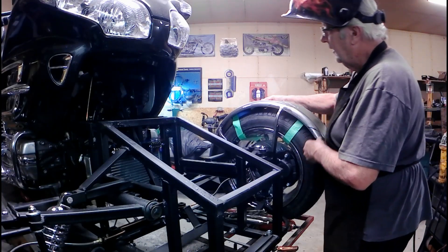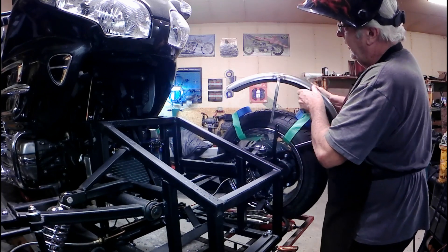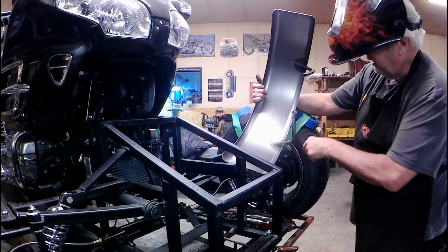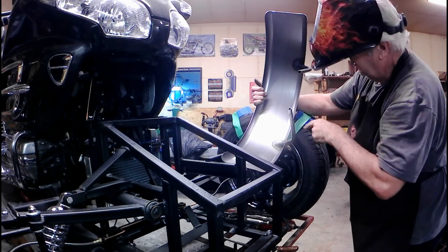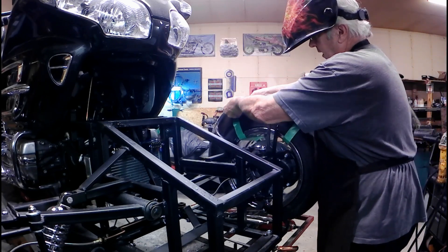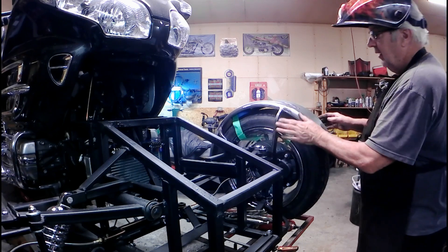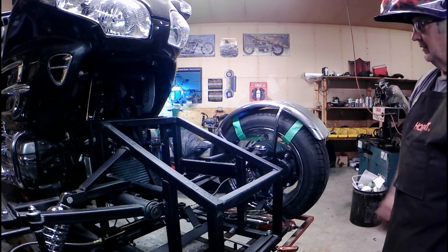I got this guy lumped together here. Looks like I missed right here — I'm going to grind that a little bit. As you can see, not only is it welded on the edge, but it's welded back here inside the fender, so it gives it a little extra strength. I've got the arch on here, so I'm going to go ahead and cut those off both fenders, get them ground nice, then I can drill my holes and toss them in the oven. Fenders will be done.